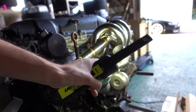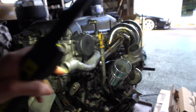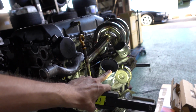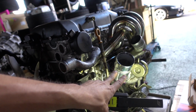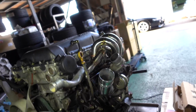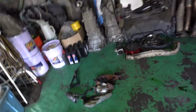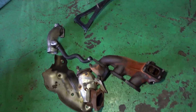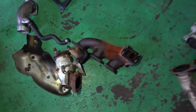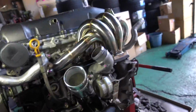So this is a pretty simple upgrade, but all these things are Yashio Factory parts, and the intake pipe is a super big deal. The factory ones have this rubber one that sucks closed once you start building a bit more boost on them. Yashio Factory exhaust manifold there for better flow. And as I did point out previously, this was one of the ones that Nissan should have recalled with the badly manufactured exhaust manifold, because they just break and snap right off on the fourth runner. So there's that. Intake pipe, we already covered that.